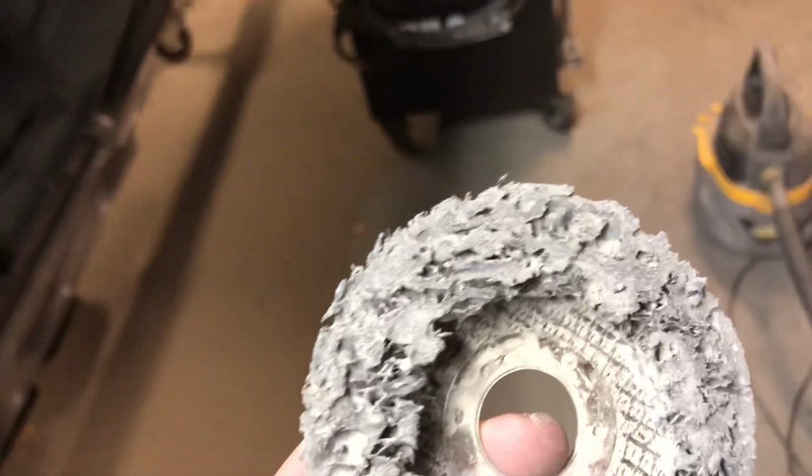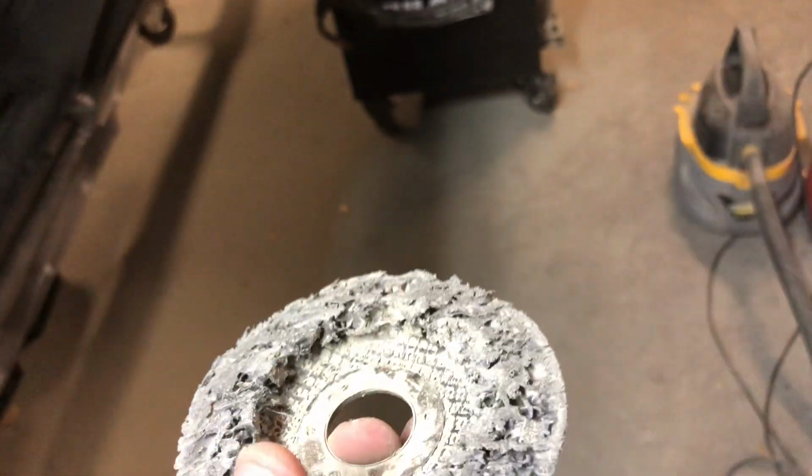So it had this gray primer that I thought was epoxy, because it seemed like it was on there pretty good. But when I'd hit it with a wire wheel, it almost would smear like seam sealer. So I'm not sure what it was. The paint stripper just sucked it off real quick. Phrasing. But as you see, it gummed it up too.